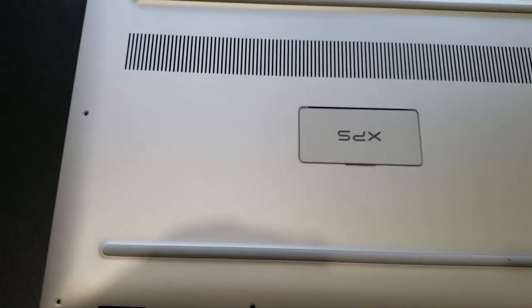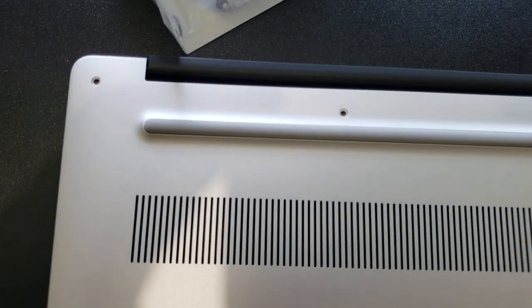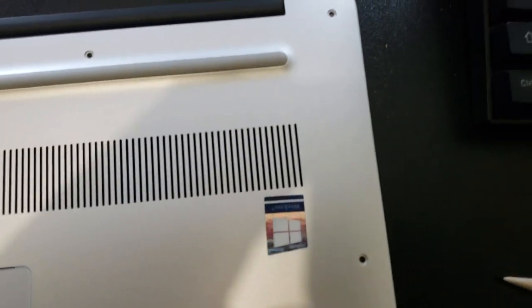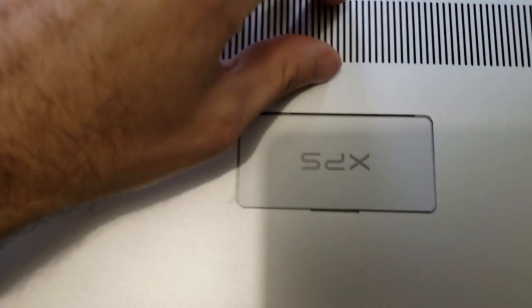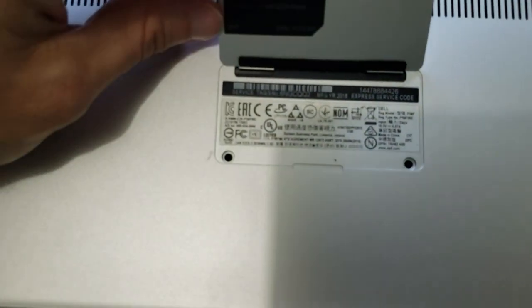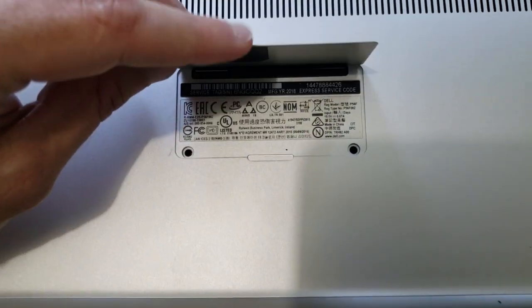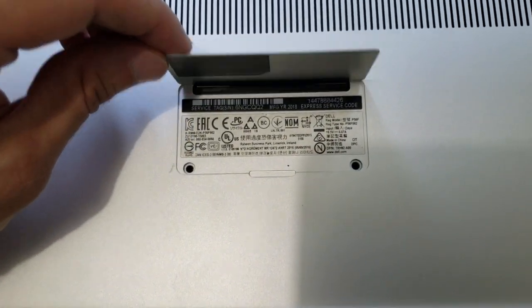This does not have the V-Pro on it. First thing we need to do is remove all the screws. I used a T5 Torx screwdriver for that — remove them all the way around. And then also underneath this lid here, there are two Phillips head screws. Pretty small Phillips head, but any smaller Phillips head should do.